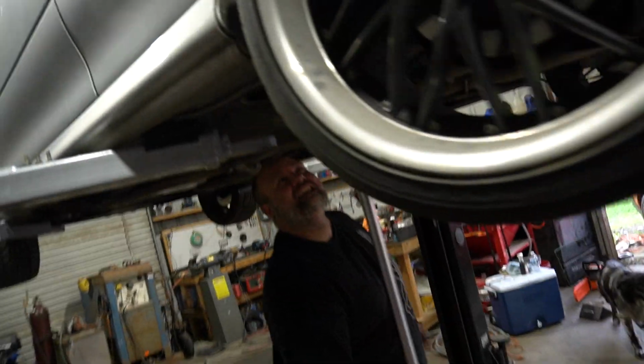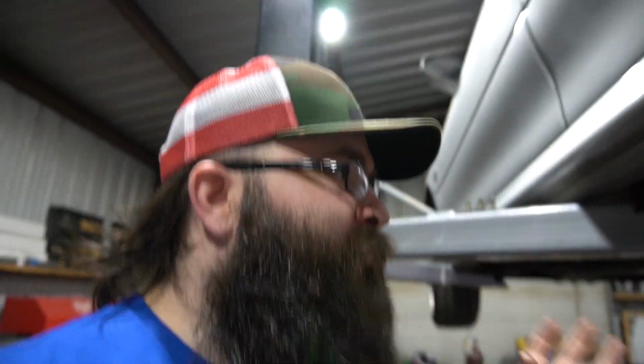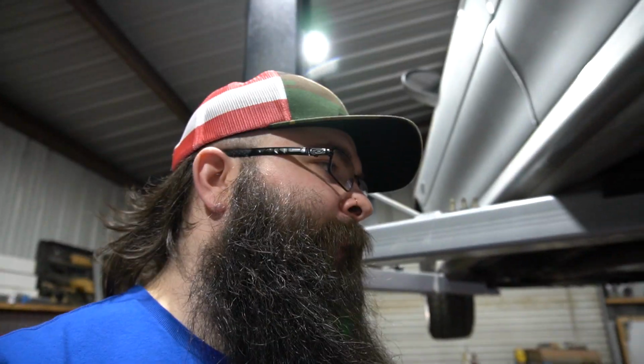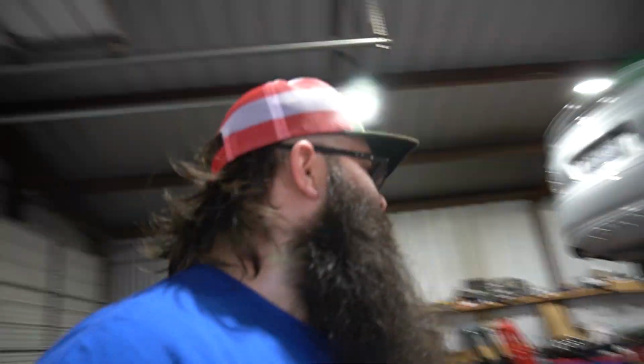Okay, well, you guys saw it there, and I don't know if you heard Chris describe, but supposedly, with the solid bushings, you don't have to get the special tool to realign the whole subframe, because it can't move. The tolerances are supposed to be spot on, so it's like a one and done kind of thing once you get it in there.